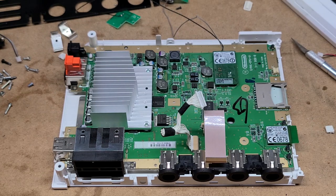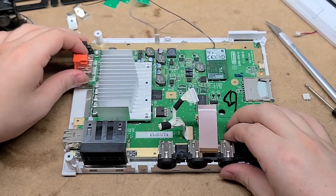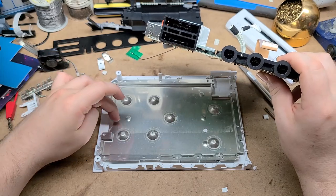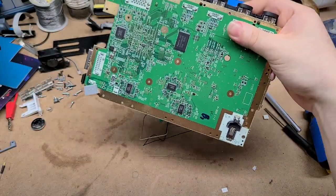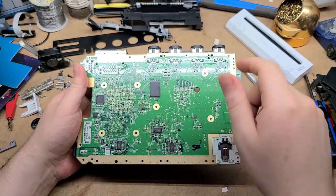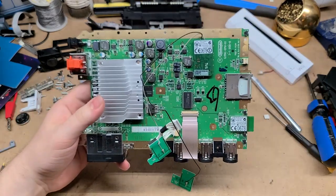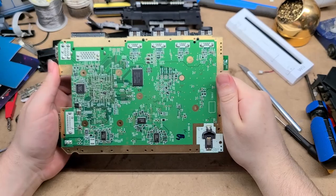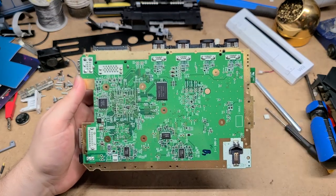Let's keep going on our disassembly journey. It turns out that the heat sink screws are the only thing holding the board into the rest of the chassis. The CPU and GPU are underneath that heat sink — I wasn't sure if they were on the back, but not surprised that's not how they did it. We are just left with the board, and there's a little tiny thermal transfer pad to kind of conduct some of this ground plane to the chassis. CMOS battery slot right here — that's where the little battery originally was. Obviously this is not going to fit into a GameCube as is. I'm going to have to look at doing trims. I don't even know if most of the front of this board is necessary, and I'm probably not going to go with the smallest trim I can get away with just because I don't need to, so I don't have to relocate as much stuff and solder to tiny crappy places.